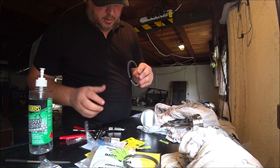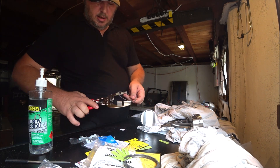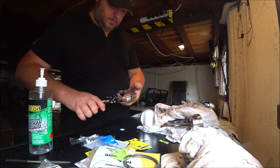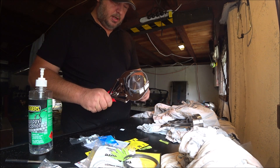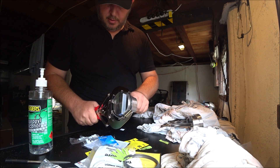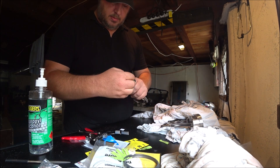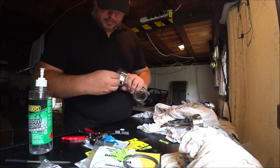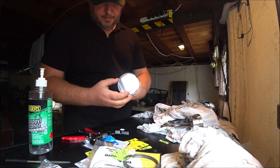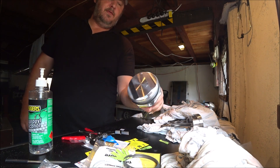These ones have a very small chamfer on the inside that goes to the top in this case. Expand the ring over the top, line it up with the groove, release it, pop it in. There we go — give it a squeeze. We have a set of rings.